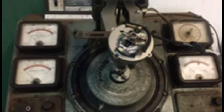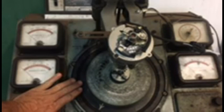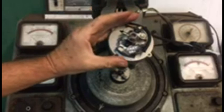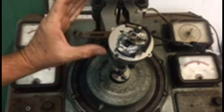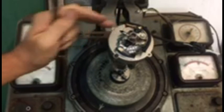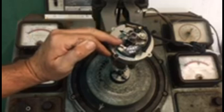Every distributor is finished here in the distributor machine. The distributor machine can run the entire ignition separate from being in an engine. This is a 1947 Sun distributor machine — an excellent tool, but not too common in shops these days. In the machine, we're going to set the ignition. When you get the ignition, it comes complete and ready to go, ready to drop right into the motor — requires no adjustment. The adjustments are done here in the machine. The first adjustment is setting the points to the proper gap, then checking the ignition timing, and matching the ignition timing with the electronic unit.